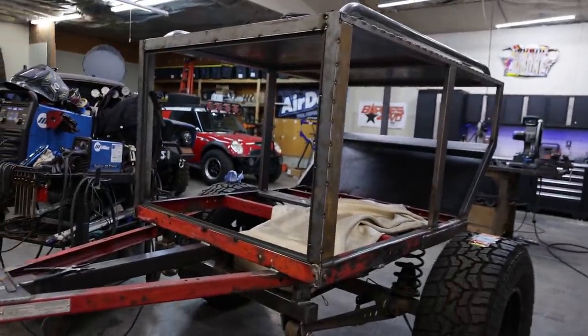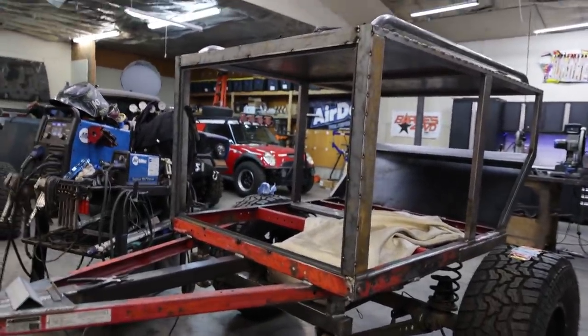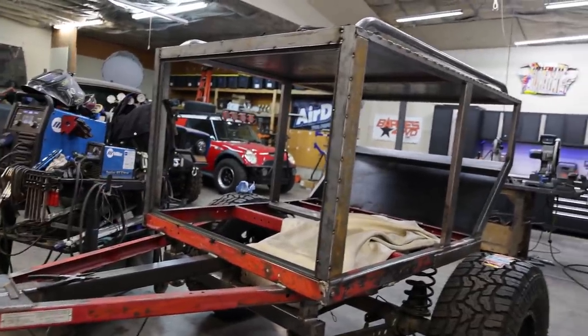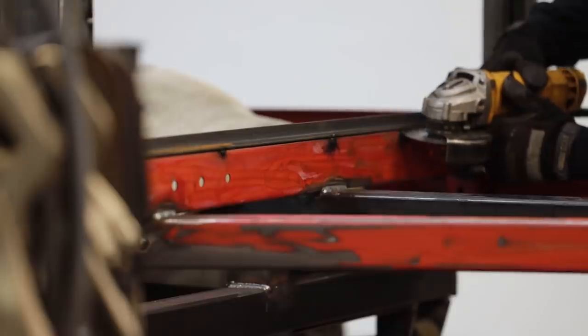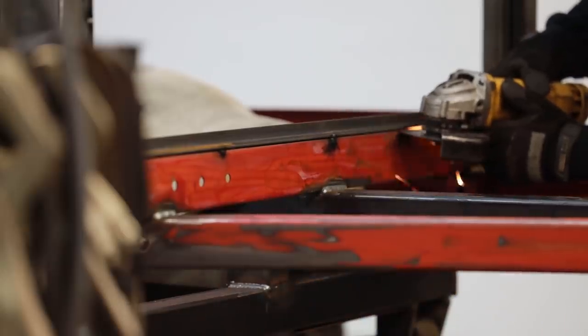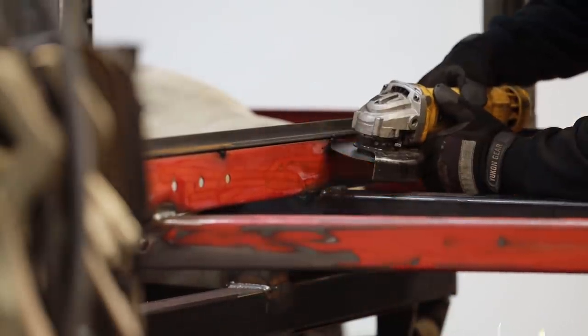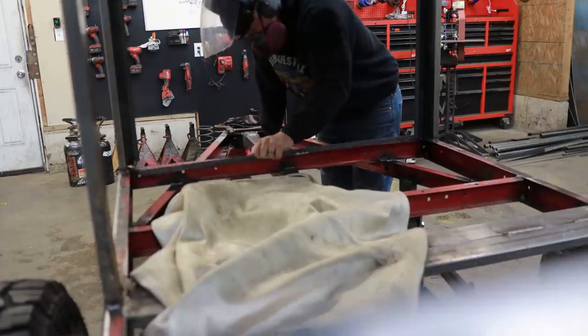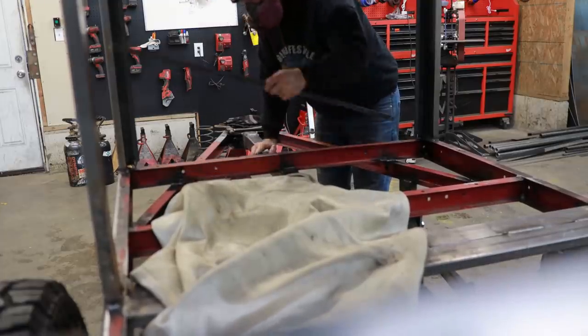It's not super important to me that this is dust-proof or waterproof, but we just want to reduce the amount of stuff that's going to get into this while we're driving around and using it. I made a little mistake whenever I chose the mounting depth for the lower part of this sill, but this is a great example of when it's nice to have tack welds instead of complete welds as you move along. All I have to do is cut a couple of these tacks, move it to the right depth, and then re-weld it.